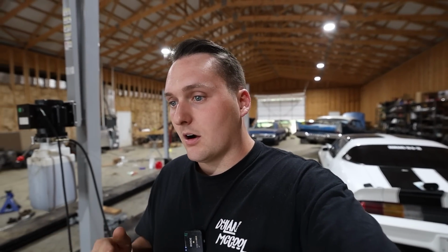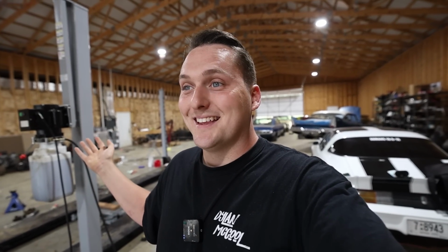So the how-to tells you need power in the crank and run position from the same wire. And I found that in the original harness of the police car. So naturally I hooked it up and said we're good to go. Except this wire also powered the alternator. It just so happens that alternators cause so much interference, and the voltage regulator, it was dead.